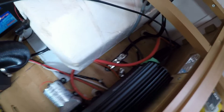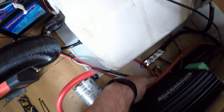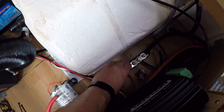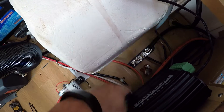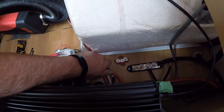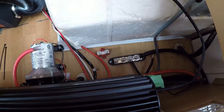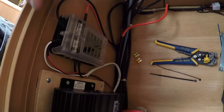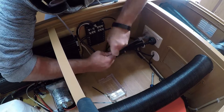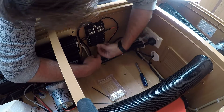I'm going to terminate that over here. On this side I've got the negative bus bar. I've been wiring up all my negatives so I don't have all of them going back to the shunt and being messy — they all come here. I've also grabbed a positive bus bar setup. The big cable coming from the battery goes to one side, and from the other side it feeds the Redarc battery manager and also an auxiliary fuse panel. I've got it fused on this cable, but I'm also going to be fusing each individual feed so I don't overload those cables.